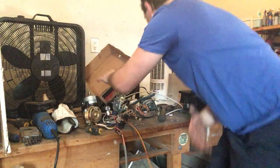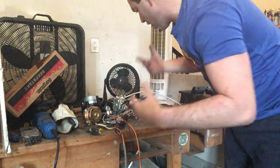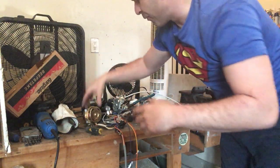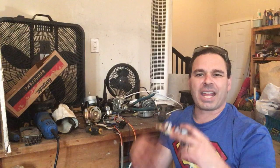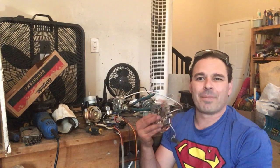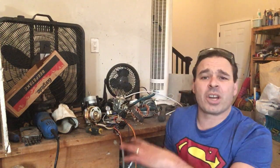And as I said, of these motors as well, some of them are going to be aluminum, unfortunately. Some of them will be copper. And again, before I start taking it apart, I definitely want to do the scratch test. If it was aluminum, I'm just going to leave it as is, and I will get my motor price for the weight, especially because this kind of aluminum would be dirty aluminum. But there's definitely a lot of manufacturers out there that are starting to use aluminum wire for all types of motors. It's cheaper. It is conductive, but it's definitely cheaper than copper. And unfortunately, I would say that things aren't made to last anymore. So definitely want to check first.